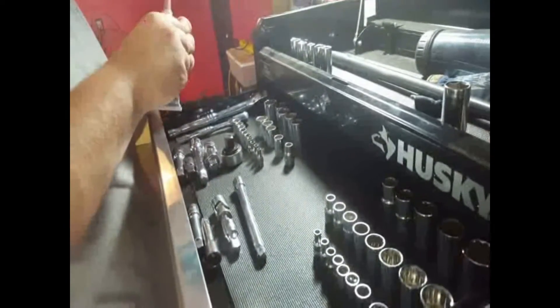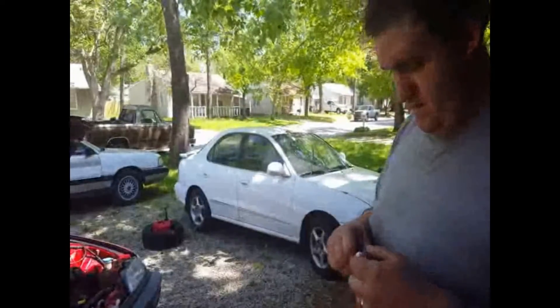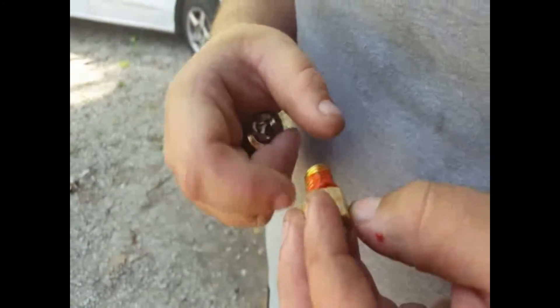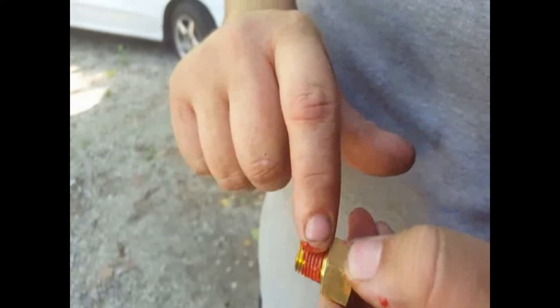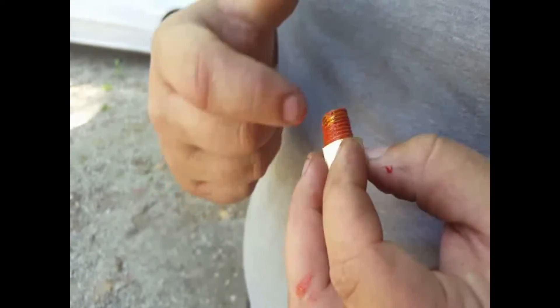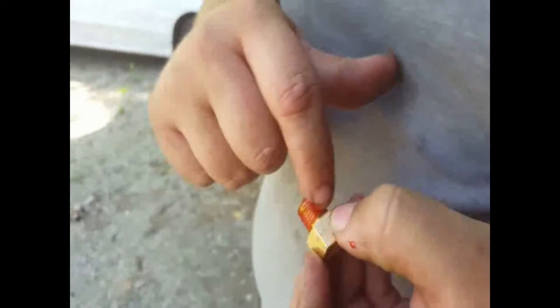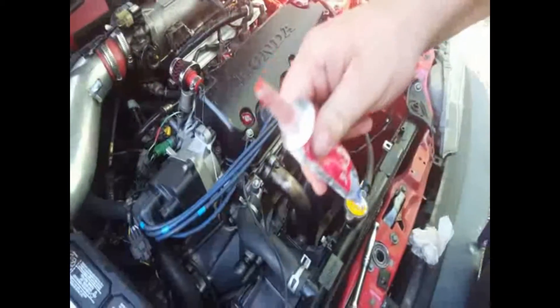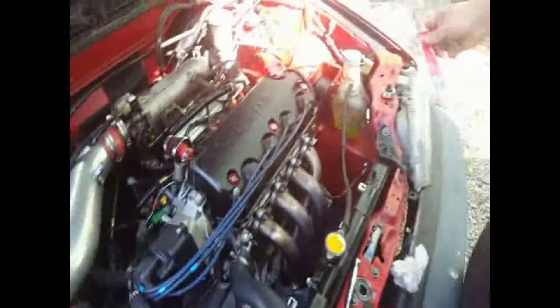We got the adapter on, let's see if it'll thread in. There we go - perfect. The ratchet's over here. Take your little nipple and just put a little RTV in there, spread it around with your fingers just like that. This really isn't what this is meant for but it serves the same purpose - believe it or not it works. I did a transmission cooler like this and it still holds. Remember - squeeze the nipple out a little bit first. There you go.